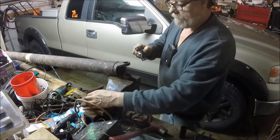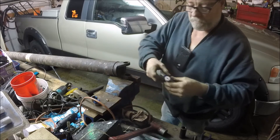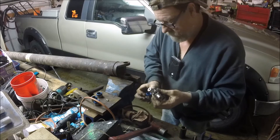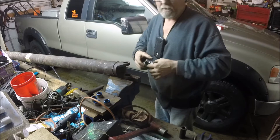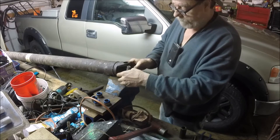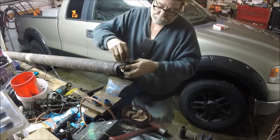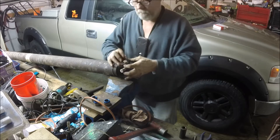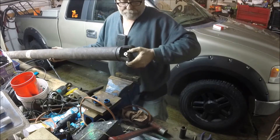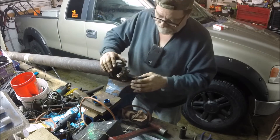Then you might as well take these caps off carefully. When you pull them off, make sure you don't roll any bearings sideways, because if you put that back on and smash it down with a rolled bearing, it's going to be a pain in the ass. Put the U-joint in there, get one of them started, push it in so you know you didn't roll a bearing. Keep holding up on that, spin it around - I was holding the U-joint so it doesn't fall out of that spot.